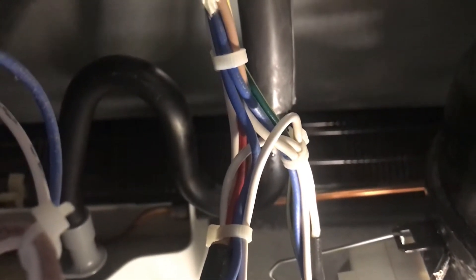Just like under your sink, the trap is normally meant to keep out sewer gas — but this doesn't have any sewer gas, so I'm not sure why they put this trap here, because this is exactly where the problem happens. When you close the door, the trapped air goes out this tube, down into the water, and has to bubble out like blowing a straw into a cup of water, and it makes those noises.